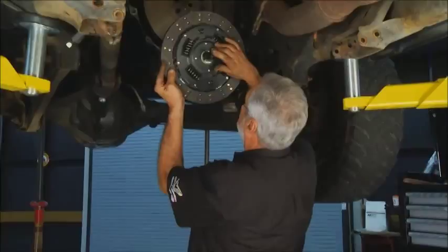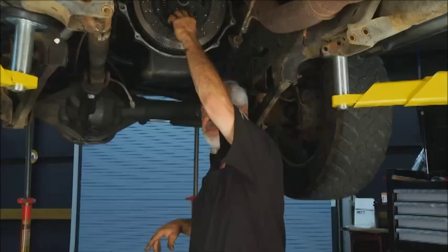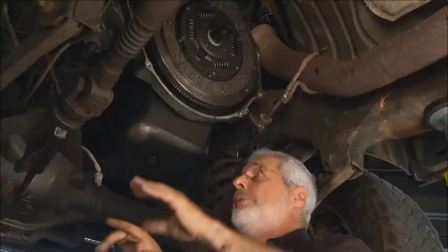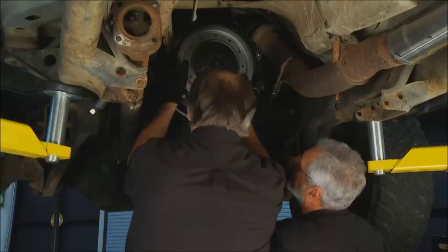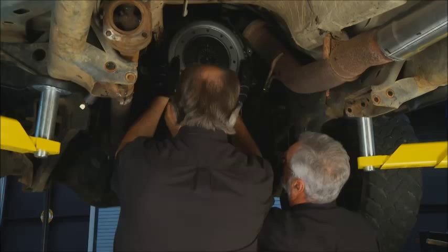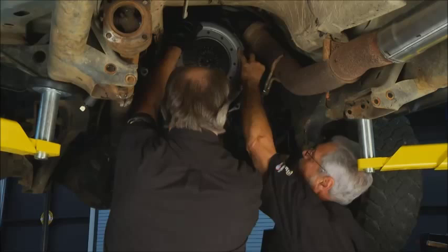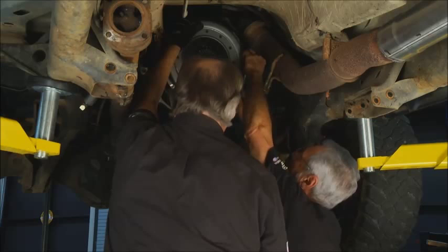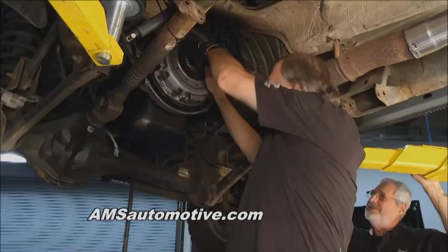Here's the clutch and the clutch plate. When you put a clutch plate in, make sure your hands are clean. They're sometimes marked 'flywheel side' to prevent putting the clutch in backwards. Take your alignment tool — which comes in the kit — and insert it. I've got no fingerprints on it and everything's nice and clean. The clutch disc is aligned; you want to do that when you bolt up the clutch, because when you put in that big gearbox you want the input shaft to slide right through the splines and into the pilot bushing. A lot of times flywheels have alignment dowels, but on some of these Dodges there are no alignment dowels. We're using the original clutch-cover-to-flywheel bolts, torqued to about 35 foot-pounds — you don't want to torque these too tight. Now we've got our pressure plate all torqued, we'll pull out the alignment tool and we're in business.